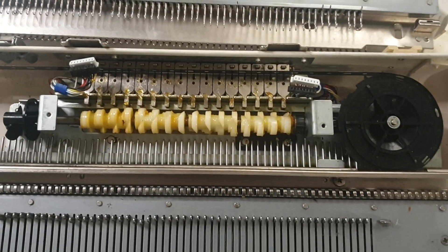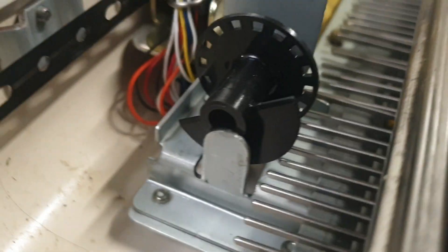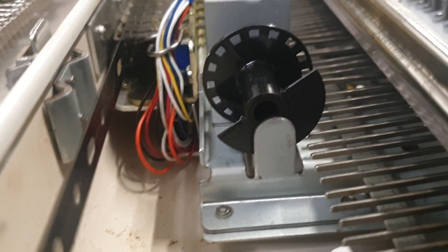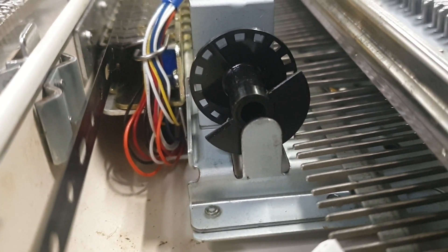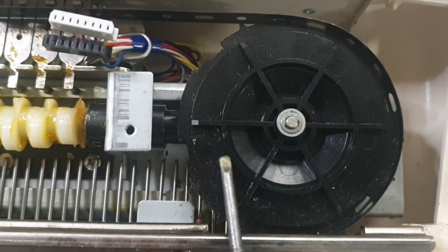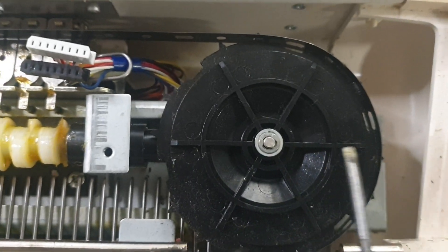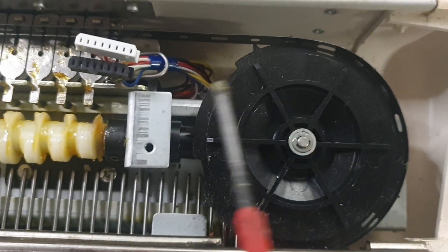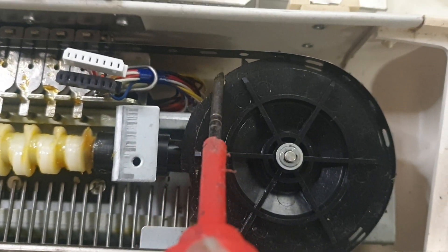What I do is I turn the belt, if the belt is on, and I make sure that the cam on this side looks approximately like that. When you come to the other side, this is what I like to see — it's lined up in a straight line and it's 90 degrees to this plate over here, and that's where your little notch is out.